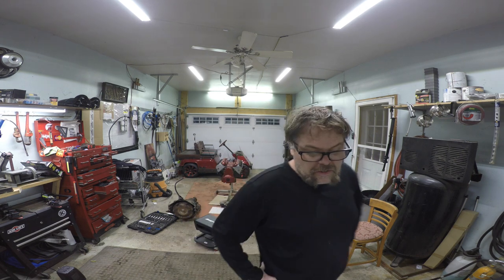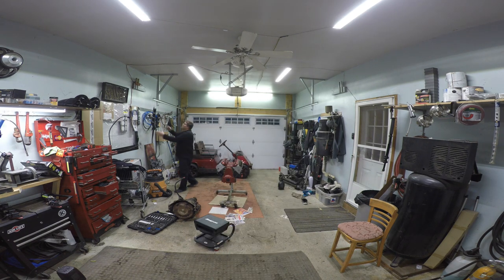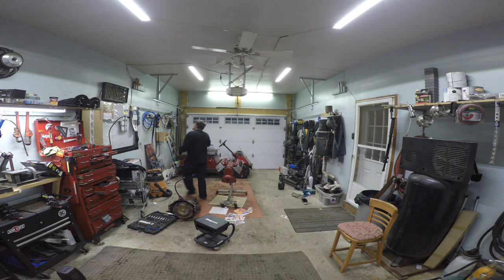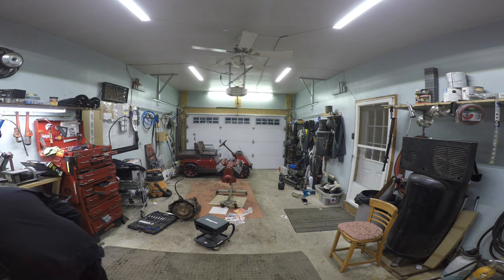I should paint the bolts too. I figured I'd have this thing back together in two hours, but I really don't want to because I don't have the other stuff yet. I'm going to put these exhaust manifolds on carefully — they turned out good, I haven't touched them since I painted them. I think the paint will be dried out. I'd love to get headers instead of these stupid things, but it is what it is. I know that's backwards, but that's how they're going to have to go because I'm running a turbo — so they go on backwards facing forward. That way you can run the turbo. If they both go down, that means I can do a crossover pipe really easy. They both go down — so the crossover pipe will be a piece of cake.